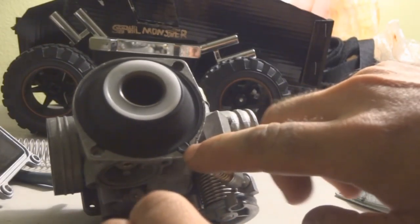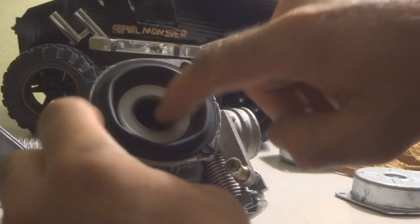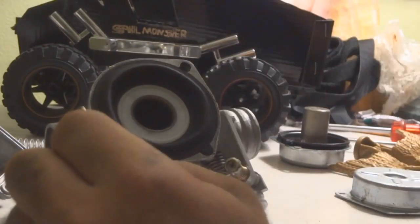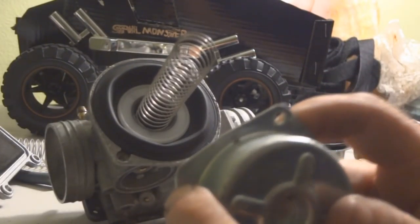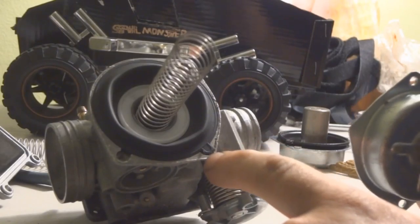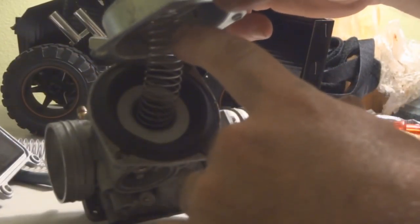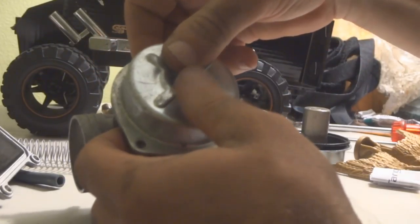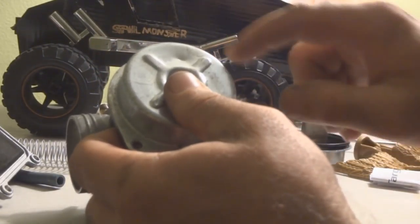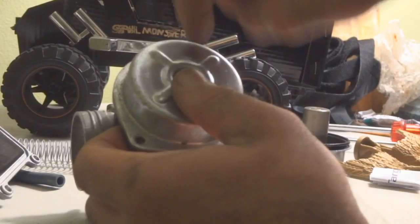This new one I got separately on eBay is 60 millimeters. Line up that little rubber tab, make sure it's in its track, and gently push it down. Then put your spring in. The cover has a little notch — make sure that lines up with the rubber part that sticks out. Get the spring seated inside the cap, press it on. There are little indentations in the cover that lock in place where the screw holes are, so it'll hold it, and then tighten the screws up.